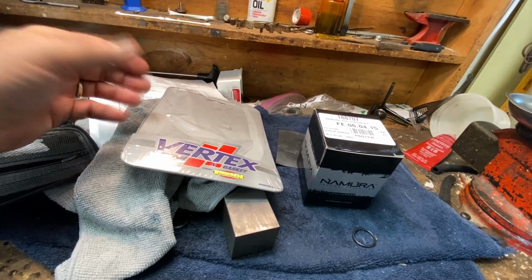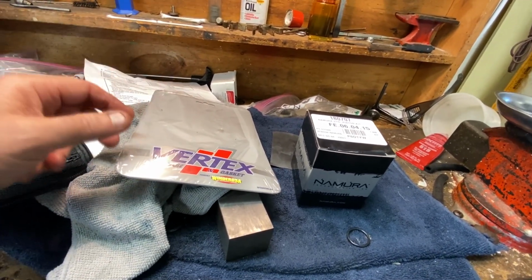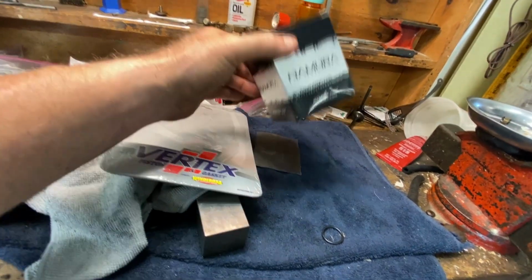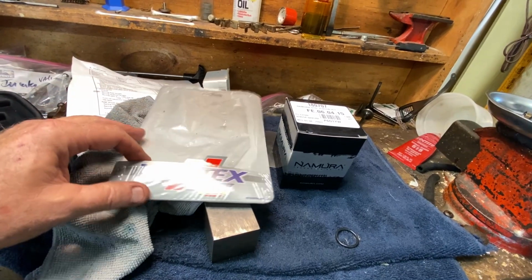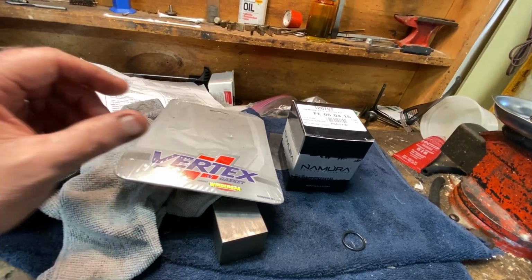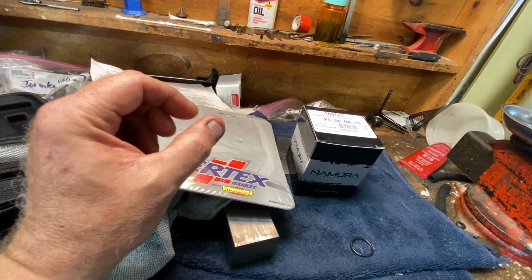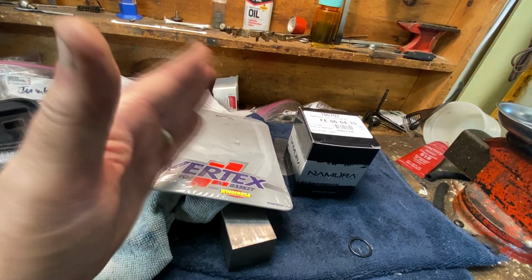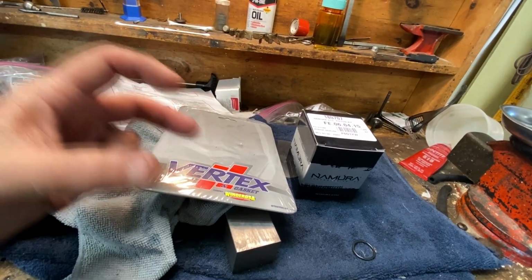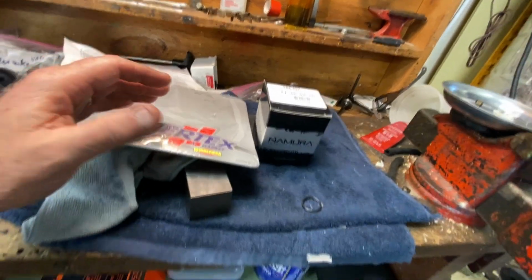And this actually has everything you need. It even has the O-rings for the top caps for the valve adjusters. And it has O-rings for a couple other things too, like the covers that go on. It's got the carb O-rings, you know, for the insulator. This particular one has an insulator with two O-rings, one on each side of the insulator, and that's the part that bolts up to the head for the carb holder side, all right? So it isn't bad. I mean, it's not a bad kit at all.